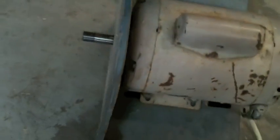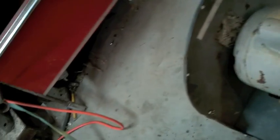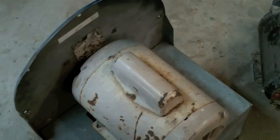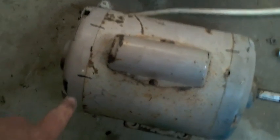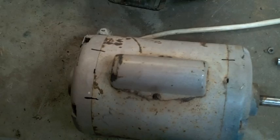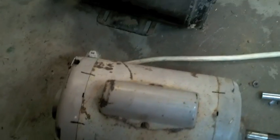You can hear why I say she needs some bearings. I suspect this is actually why this unit was scrapped in the first place, but motor bearings are cheap and relatively easy to do. I'm going to go ahead and see what's inside the old rusty girl before I make the leap to two-horse. Before pulling it apart entirely, I went ahead and put some marks on it just to help me line it back up — in theory it doesn't really matter, but it's been together this way a very long time.